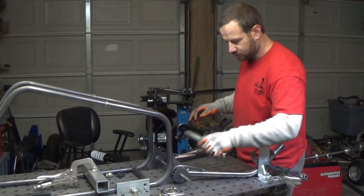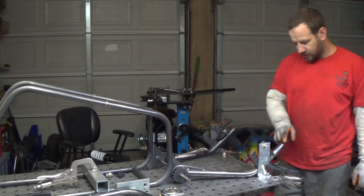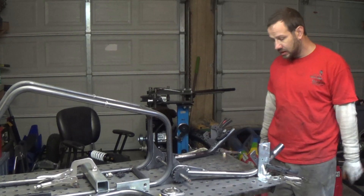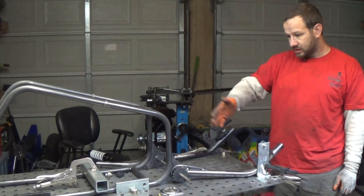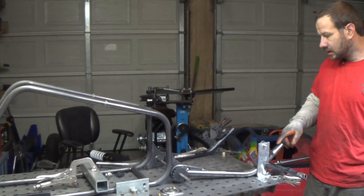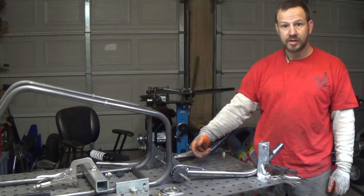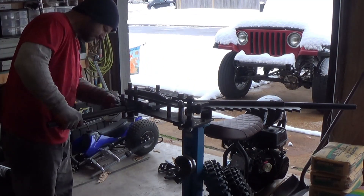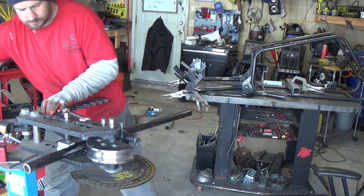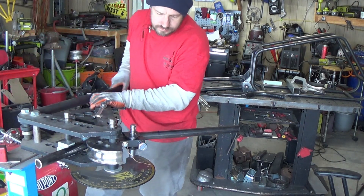I got this crossbar cut out. I'll probably just run a straight one or maybe a slight angle, but I want to get to the back of the seat. I'll bend the loop and then see how far I want it to reach and trim all the pieces. I've got these clamped out in square with everything — it's all clamped down in square. I want to fit a 17-inch piece, so I'm going to get a 17-inch piece of bent tube. Then I'll probably stick the axle back in and check clearance to see where I need to be able to clear the chain.